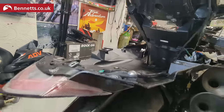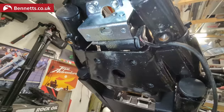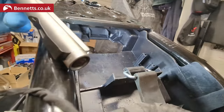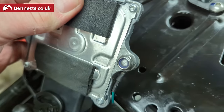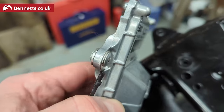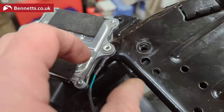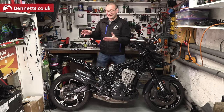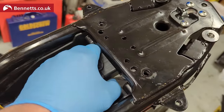I took the shroud off but it didn't help — there's nowhere that this should be screwed under, and none of the holes line up. It's under warranty so I'm not going to drill anything. I tried using a nut and bolt to fasten the cable to the body of the EFI ECU but then it wouldn't fit back in the gap. In the end I had to use a rivet and file it down, and I still had to drop the inner tray to jiggle it in. It still moves under there but the wire is now pretty secure.